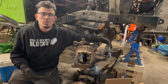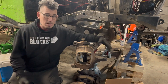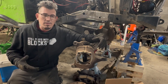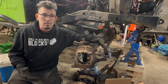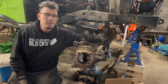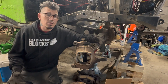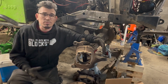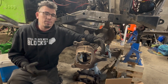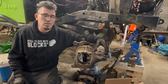The high steer arms I chose to go with are from a company called Beyond Precise. There are a couple reasons I chose them. One is that they're priced really well, especially in comparison to some of the other options out there. I was really happy with the price. The other reason is I was able to get in touch with them and talk about all the measurements for the drag link and the tie rod. After talking to them, I figured out that these are drilled perfectly for swapping this axle underneath the Jeep.